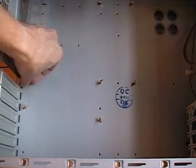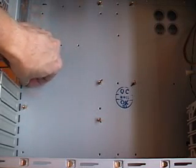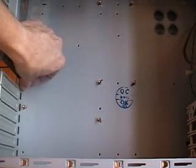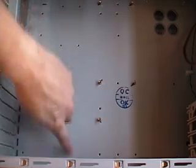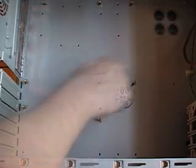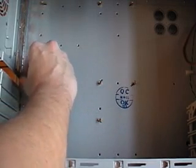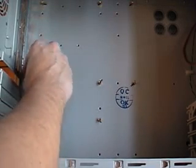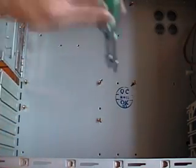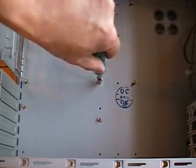This board is kind of an unusual one. It's a micro ATX board, which means it's only going to go down this far. That part's normal for a micro ATX board, but it's really deep. Most boards are long and skinny — they go this way, they give you all the slots, but they don't go this far out. I'm going to double check these. I don't want to over-tighten them — I just want to screw them in by hand right now. Once I get them all somewhat tight, I'll use the nut driver and tighten these guys down. I just twist it with the tips of my fingers — probably not even two or three foot pounds. It's just a really slight twist.